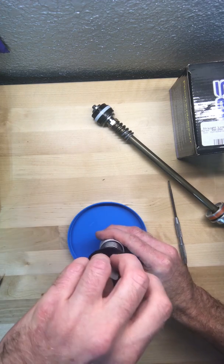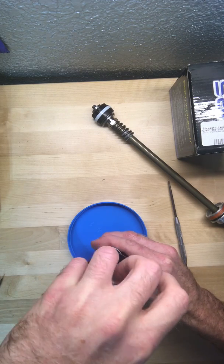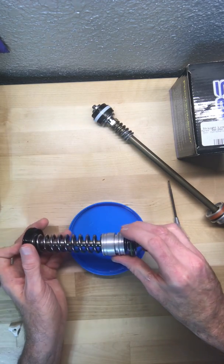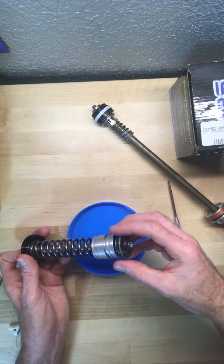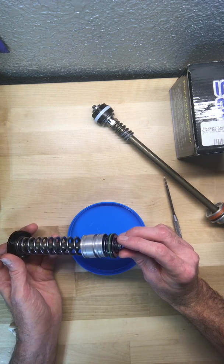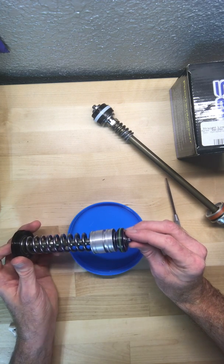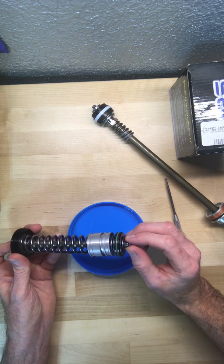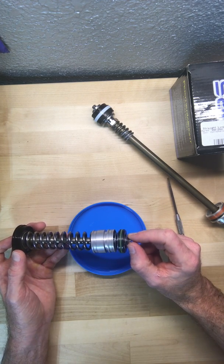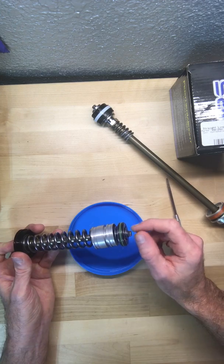This part here — it wasn't necessary for me to take this entire stack apart. When they do a revalve, they're only going to be disassembling this bottom portion here. If you ask my parents, I will take apart anything all the way down to bare metal just to see and understand how it works on the inside. The most difficult part about it was cleaning up all the Loctite off of the threads so that I can get this back together properly and get it to seal correctly.